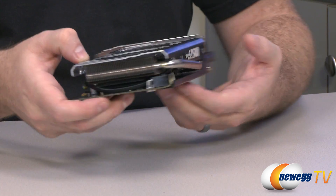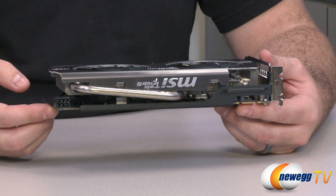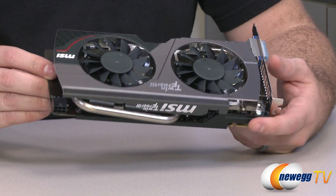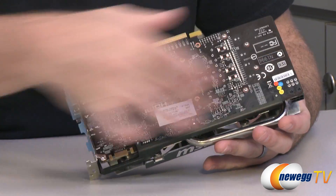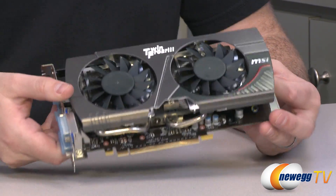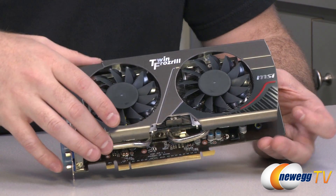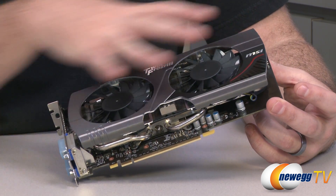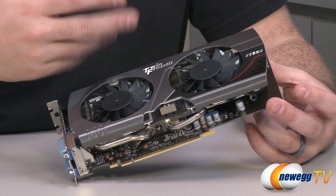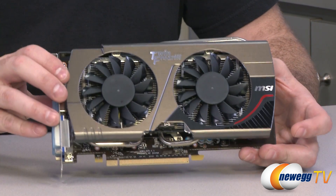I've had a chance to look at quite a few GTX 660s, and this one definitely ranks among my favorites. I like the custom design and the detail work — the look in general is quite nice. It's got a brown PCB on the back, and flipping around to this side there's a gray and black shroud over the heatsink. This is an open cooling design which, in my experience, performs better thermally for the GPU, though it does eject a bit more warm air into your case.